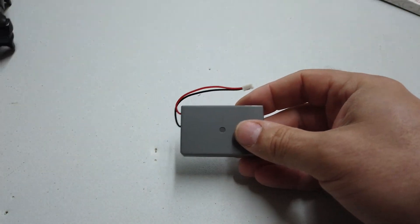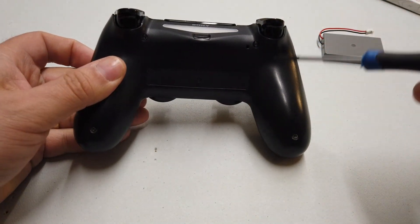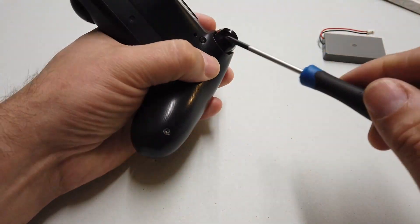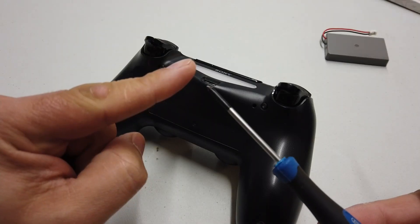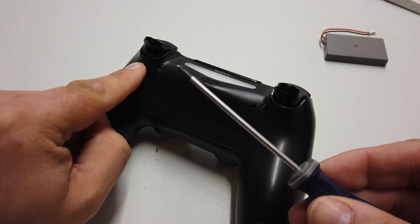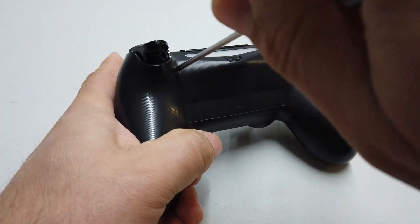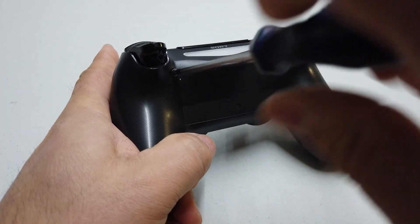Next part of the mission: get into the handset. The handset on the bottom has four screws. Make sure you select the appropriate size screwdriver bit so that you can get a good purchase on the screw heads — they're quite small and quite fine. I found with the first screwdriver the tip was just a little bit too pointy and it started to round off those screw heads. This one, however, is the right size — a lovely fit into these screws and it's working an absolute treat.